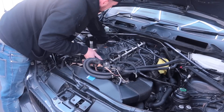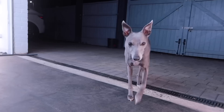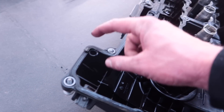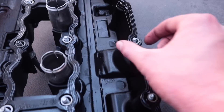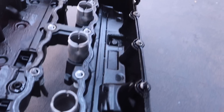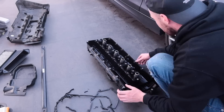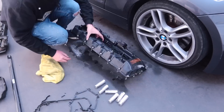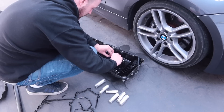As soon as those bolts were off, we could start wiggling off the rocker cover. We finally have it off, and it's easy to see why it was leaking — it's got splits here, there and everywhere, and is very dry and brittle. It just snaps like that; it's definitely past its best. After removing the old gasket, it was time to clean up and inspect the rocker cover for cracks — apparently these are quite common to split, but thankfully this one looked okay. So time for the new gasket to go on.